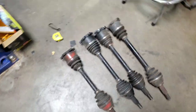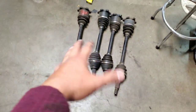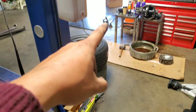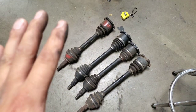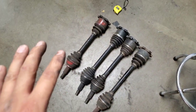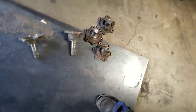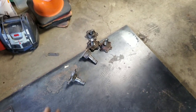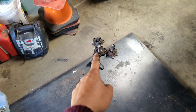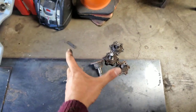So yeah, we'll put them back in, go out to SEMA with Hoonigan, have a good time and see what happens. For most of you doing the swap, it's a wonderful swap. You can actually cut it and do it the way I did to save money — it's really good, as long as you don't drive stupid hard. My car puts out maybe 650–700 horsepower and you know the way I drive it — right off the rev limiter — so that's why the axle stubs are breaking. But up until I changed my driving style very recently, those axle stubs had no issues, even doing FD Pro 2 stuff. They never broke. So I would recommend doing it like this yourself — you can save some money and you don't have to get the expensive axle stubs or the expensive 300ZX axles.